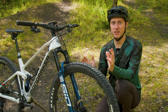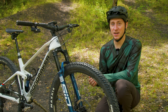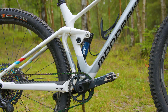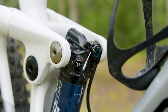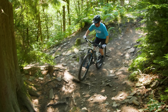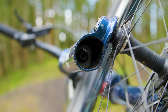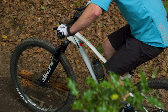While the new 35mm SID will likely hog the limelight, its lightweight 32mm leg stablemate hasn't missed out on some key updates. For more details on that fork, along with even more tech on the new SID, be sure to head over to the news story on BikeRadar.com with the link in the description. Moving rearwards on the bike, just like the SID and SID SL forks, for 2024 the SID Lux shock moves to a new 3-position damping system. Externally the chassis remains more or less the same as the previous version, though RockShox have made changes internally to create a shock that closely mimics the feel of the forks. You'll still need a 2.5mm Allen key to alter the rebound damping, but if you have a SID or SID SL fork, you can use the 2.5mm Allen key that doubles as the rebound dial.